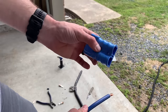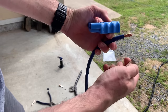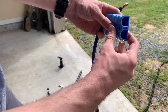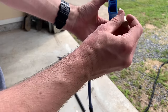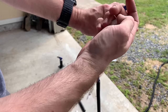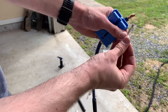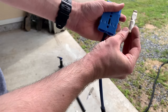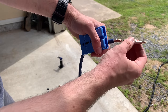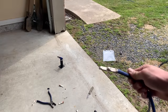Now I've got this Anderson plug right here, and this is the Anderson lug. I've got to crimp this to this wire because this is what locks it in. This will be on the side of my truck, crimped to the wire, and it locks in. Inside are these little metal tabs — when you stick the Anderson plug in, it pushes them down and locks past this little lip, so it locks in place. Not the best crimp job, but it ain't going nowhere.